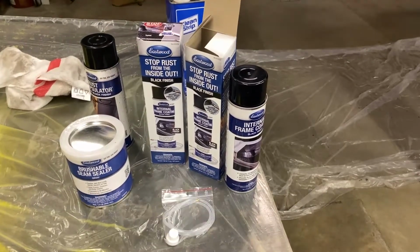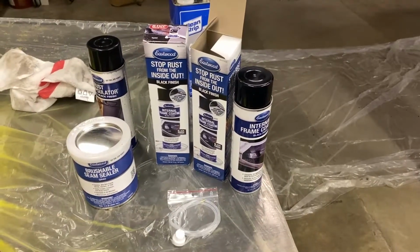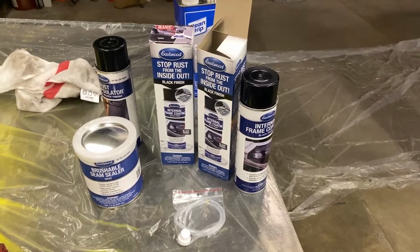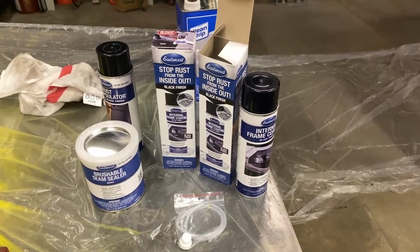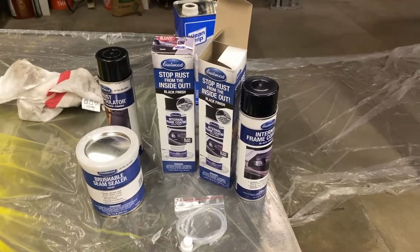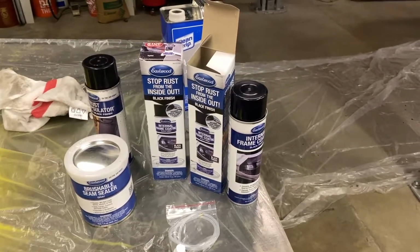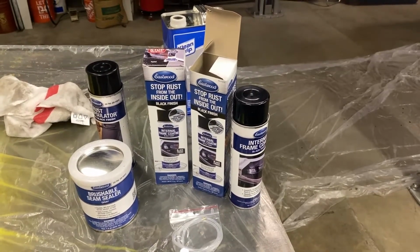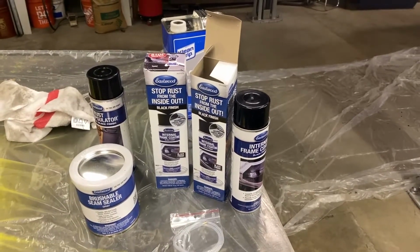Inner rocker coating. So you saw the inner rocker panel. We had Caleb, he painted with a rust encapsulator before we put the outer rocker panel on. But of course we had welding, some additional metal work we did, that notch for the rear door, and of course all the welding to actually weld the rocker. So that I'm assuming is burned away, left exposed.